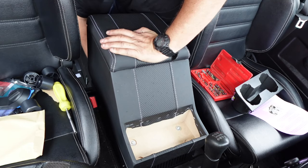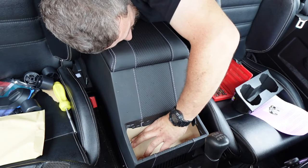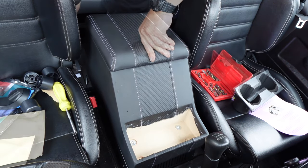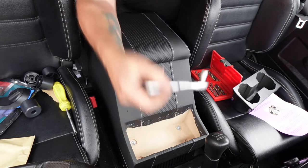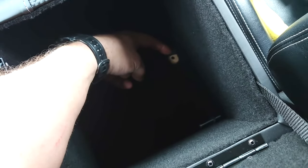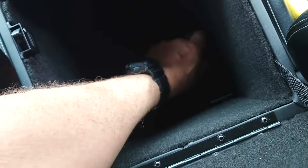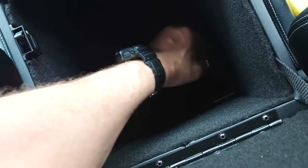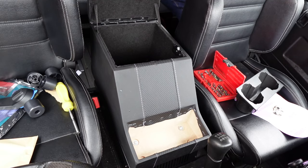You might find it easier getting access from that front plate if you've got the sub installed. Because we haven't got the sub fitted, I can just get them straight on quite easily. I'm going to go inside now at the bottom where the sub would be using my socket. If you have got the amp in there, you're going to have to go from the front. You can just make out down here one of the positions for the bolts to go through the cubby box inside. Just lift up the carpet — there's actually another one further back which is the one we need, so don't get it in the wrong position. All our bolts are in, we just need to tighten them up because they're all now located. I'm going to do the back ones first.